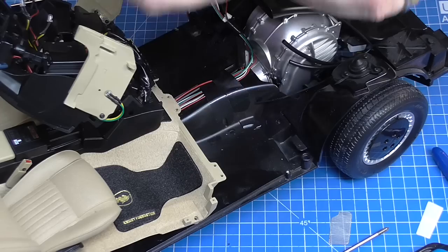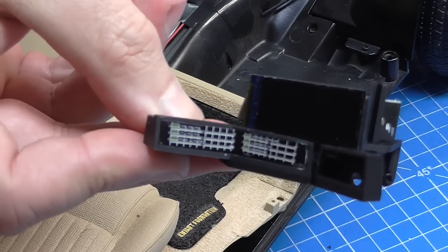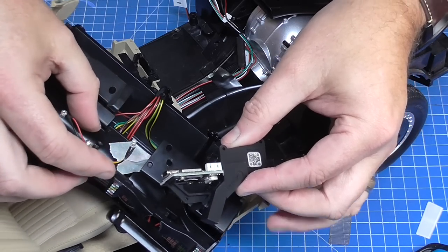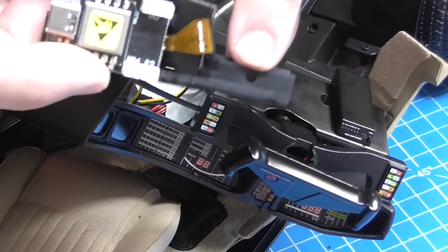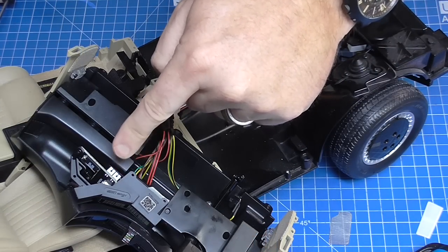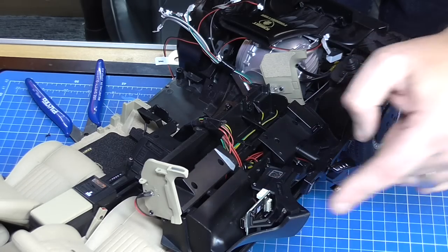Excellent. I then want to take out this section from this part - when that's out, it looks just like that - and I'm just going to put that into the cavity here. I've already got rid of the lead from the screens we had before. I do need these LEDs connected to the yellow and black, which go in the two holes just underneath here. I've got one yellow and black lead going in this side, one going in here, and the red and black lead going into this end. I'm just putting the BP screws in to hold this unit into place - just three BP screws - and that unit is now in place.